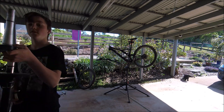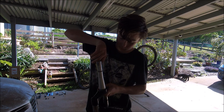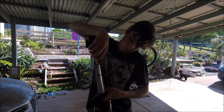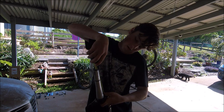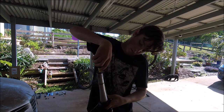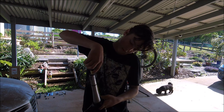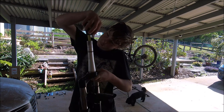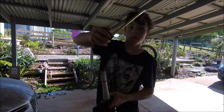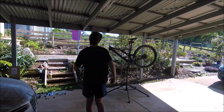It's horrible if you do. So here's my fork's steerer tube — you're gonna measure from the bottom of this thing to here. About seven point two inches, 180 millimeters, nearly 185 millimeters. That's how long my steerer tube is. Double check — there you go. Going to the Machetes now.